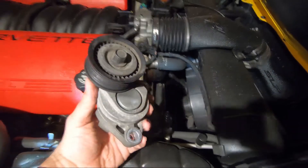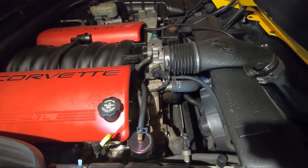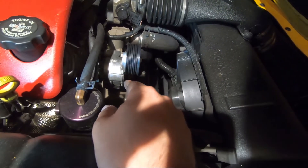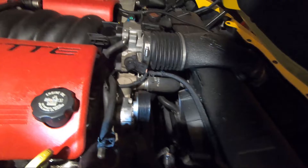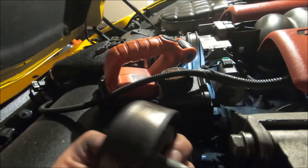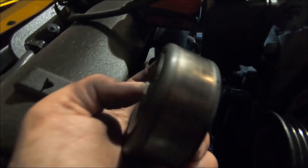Easy day. I'm like six minutes into this job, not too bad. You want to torque these down to TAF — tight as f***, and do a quick visual inspection. Make sure everything's square, nothing's bent, caught, or binding. Let's get that pulley out over there. It takes some hand and finger gymnastics, but you can get it with an open-end 15 millimeter. Taking this power steering reservoir off would probably make the last five minutes of work really easy, but this little guy came right out anyway. I'm going to throw the new one in and torque it down.